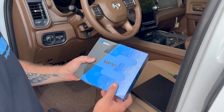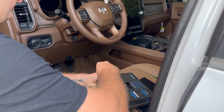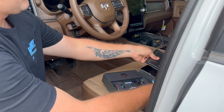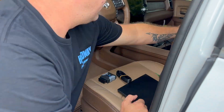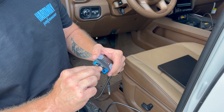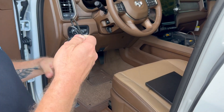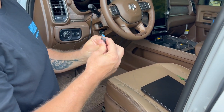So we've got the MPVI3, comes in this fancy box. Open that guy up, flip it over, you've got some tape to deal with. USB-C end goes into the MPVI, MPVI goes into the truck — into your newly installed secure gateway bypass cable, of course. So you can sit in the truck. A little pet peeve I have is to run that over the steering wheel. USB port plugs into the computer.